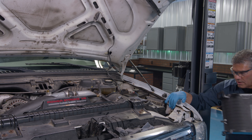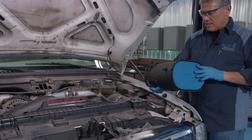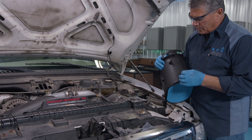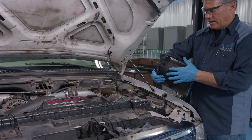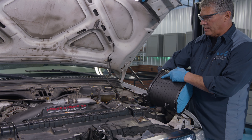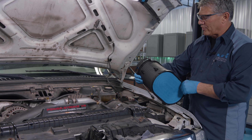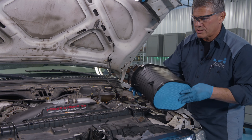We're back to our F-250. We're going to replace the air filter in it now. These sit down on rubber grommets on the bottom. They clip in here pretty hard, so you've got to wrestle with it a little bit to get it out, so have some patience. There is an arrow on it facing the engine — that way you don't attempt to put it in wrong. The arrow goes towards the engine.